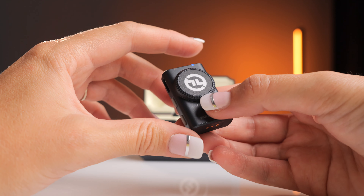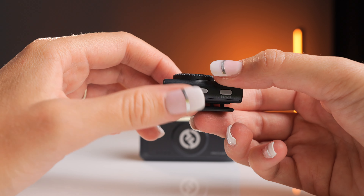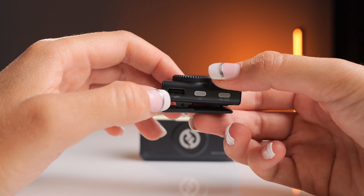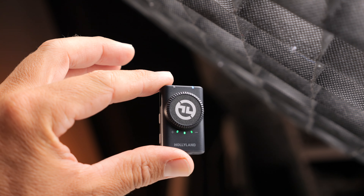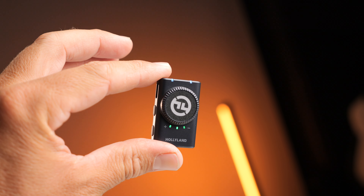If you buy the camera version and have a USB-C to USB-C cable, you can plug it directly into your phone and it will work — and with a USB-C to lightning adapter it will work on an older iPhone too. Just remember that when plugged into a phone, the receiver detects it and the lights turn green, indicating mono audio — you cannot get stereo from the camera receiver into a phone. If you double tap the transmitter button while using the Lark M2 on your phone, it will automatically start or stop recording on your mobile device.